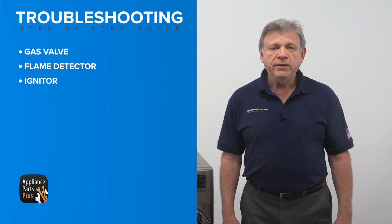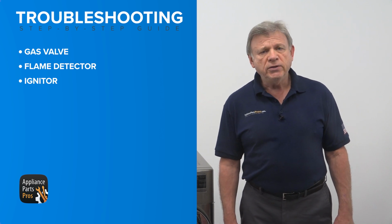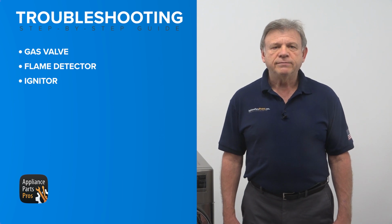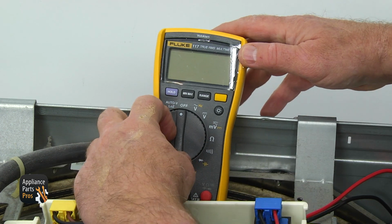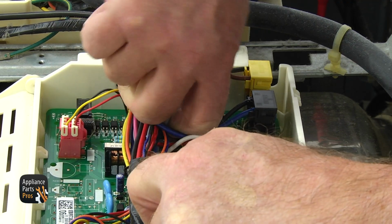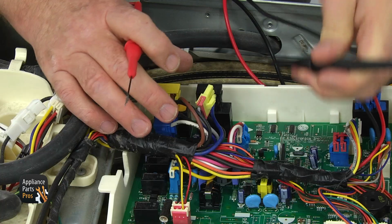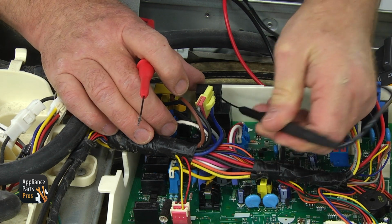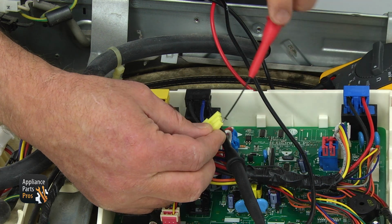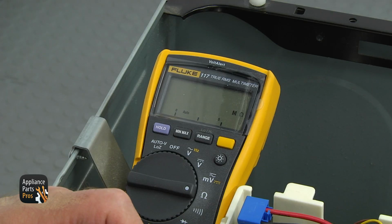That causes short cycling, longer drying time, and eventually no heat. We can test the dryer igniter from the main PCB. Set your multimeter to resistance, the horseshoe-like sign, to K ohms. Unplug the black relay and yellow YL3 plug, and touch with the meter probes the blue wire at the relay and number 3 gray or black wire at the YL3. You should read between 50 and 800 ohms. If the reading is way off or there is an open circuit, the igniter is doomed.